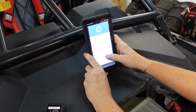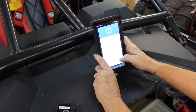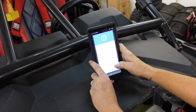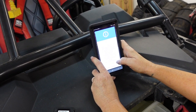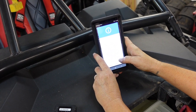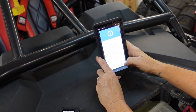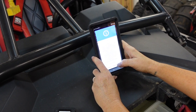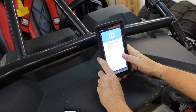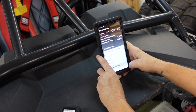Stage two requirements: 91 or higher octane fuel, wastegate crack pressure should be stock at five and a half pounds. Recommended components include aftermarket race exhaust, EVP charge tube or blow-off valve — we don't have those — and a turbo air inlet duct. Clutch shift-out RPM is 8,300 to 8,500, with a rev limit of 9,300 RPM. We're not going too crazy on this stuff because we're going all the way to stage five before Glamis, which is only about three weeks away.